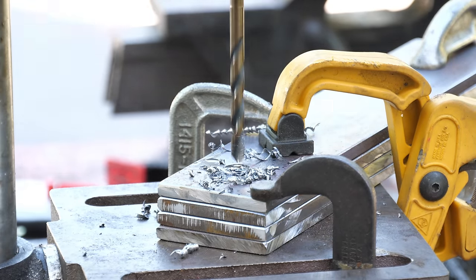The upper end fits a little bit snug, but we eventually managed to get it aligned and bolted in place. Then, with some maneuvering of the leaf spring, we've got everything locked in. We'll get the shackle hardware snugged down and let the axle off of the jack stands. It's no surprise that the shackles are still pointing a bit forward, which is not great for ride quality, but we'll just have to see how everything looks on the ground when fully assembled.